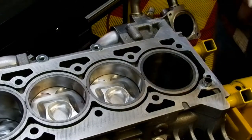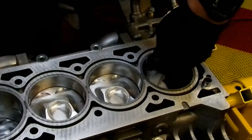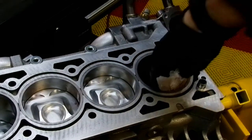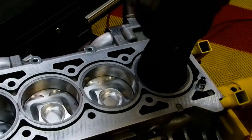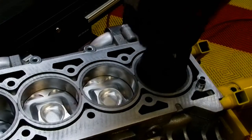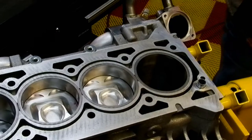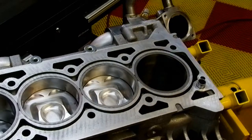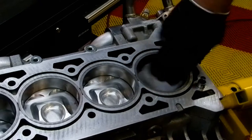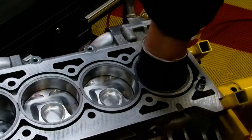these bores are really clean anyway. I know that. But you just keep on going here. Give a good scrub down. Give some nice lubrication to the surface. And at the same time, cleans her up real nice. So what I do is do that, take a look at it. Yeah, there's nothing here at all. These bores are super clean. I mean, I've probably cleaned them a half a dozen times. Take another new filter, give her a once over again. Get right down at the bottom here.